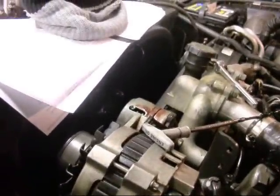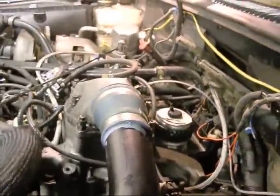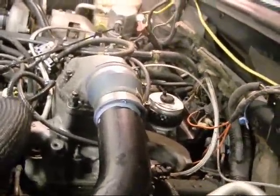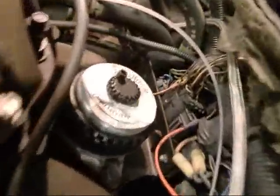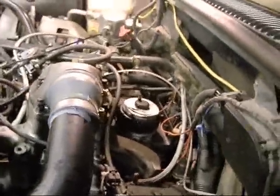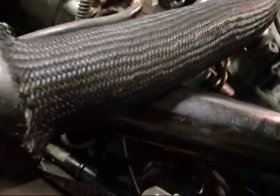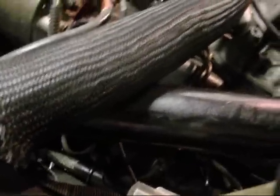Clean off the sludge on the dipstick. Change the fan clutch - brand new AC Delco, but it doesn't disengage. I don't know why that is. I was reading on one of the forums - somebody sent me a link about how to put in the newer style glow plug controller. What a mess of wires on my blazer. I got the one that goes in the block into the antifreeze, but it doesn't work. He recommended I put in the newer style - I don't want to put a push button on. Put the bolt in and keep on working.